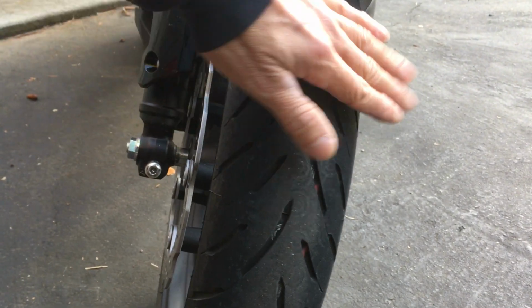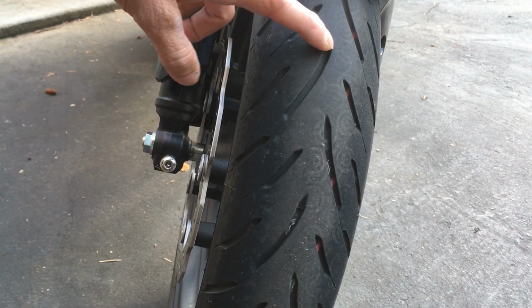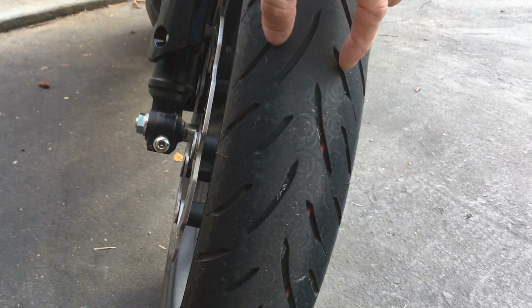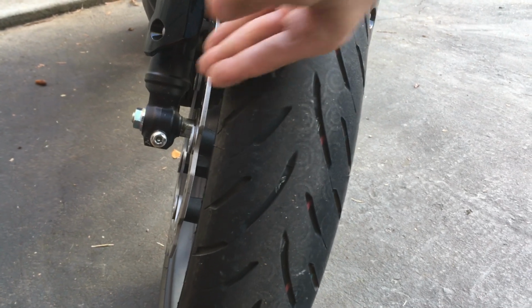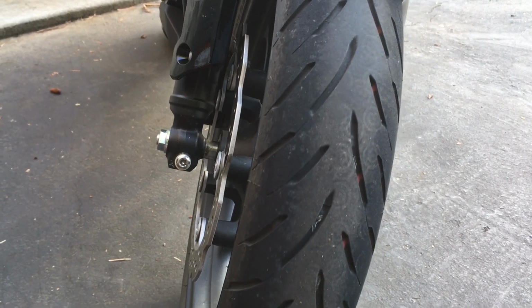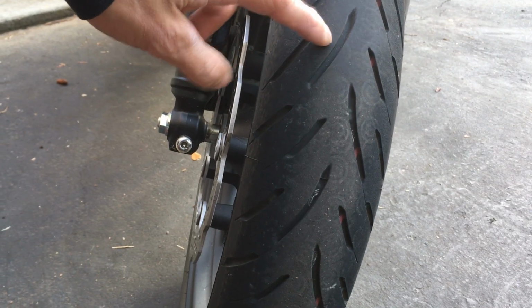If you want to steer a little faster, you use super sport style tires, where they're more angular. The sides are more angled, so if you look at the profile, instead of being round, it looks more triangulated. The center is more narrow and the sides are a little straighter, flatter. Those lean over really quick. But I don't want to run those tires because they're more expensive, and they also wear out pretty fast. This one wears out pretty fast too because these are very grippy.